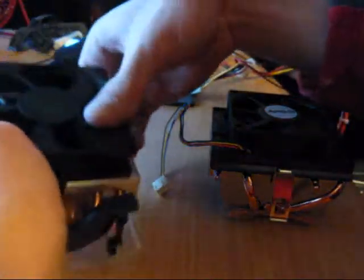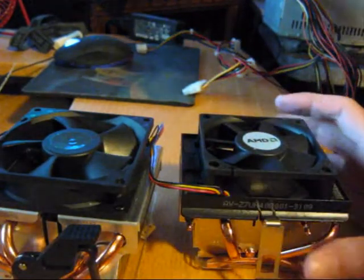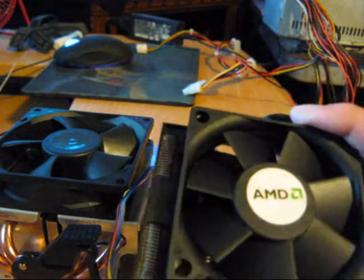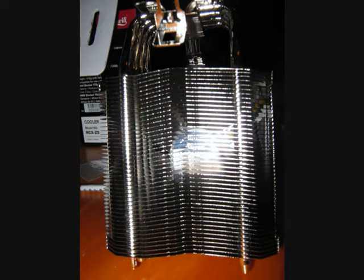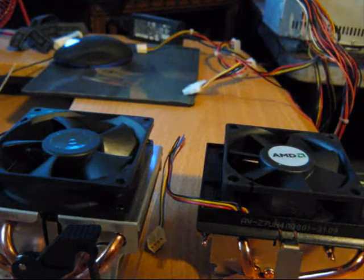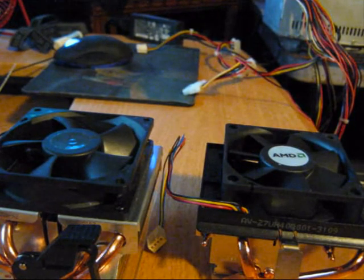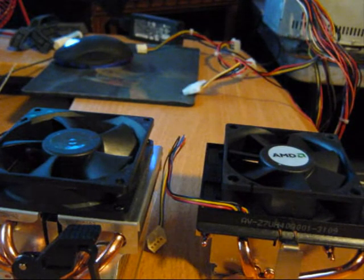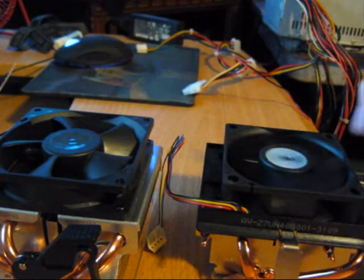And just to give you an idea about temperatures, of course I never plugged up this cooler because it was going in a $1,400 gaming rig. It's going to be overclocked. With the CPU at the stock clocks and voltage, with a Rosewill RCX-Z5 92mm heat pipe cooler, I saw temperatures at max load typically in the low 50s, like 52, 53 degrees Celsius under Prime95. When the CPU was overclocked from 3.4 gig to 3.7, it typically ran in the mid 50s. So this little thing here ain't got much cooling power, in my opinion, if you're going to be overclocking it.